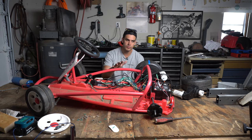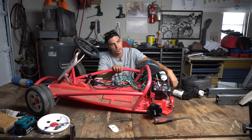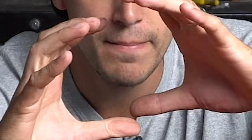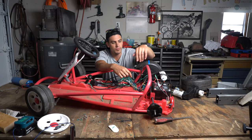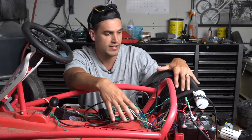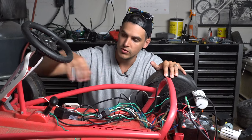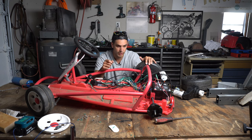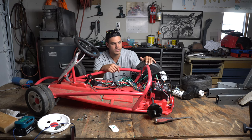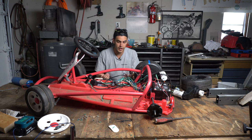So here's the plan. I've been researching bigger motors — not these, but electric scooter motors, electric go-kart motors, big motors with chains on them. I'd like to keep the two batteries because I know they're fine. I want to put a sprocket on the axle and make this a live axle, so the wheels are connected directly to the axle, put some bearings on, put a big motor on, and add a DC motor controller with a pressure-sensitive foot pedal. And I'd like to do it all using minimal tools, so any parent out there can probably do it with a small amount of handiness — I'm going to try not to use my welder at all.